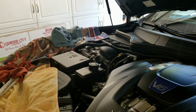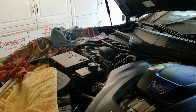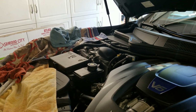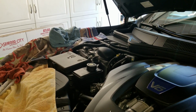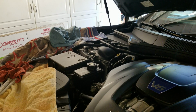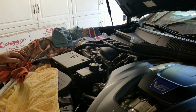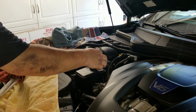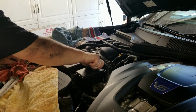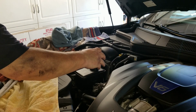Okay, I'll turn the steering wheel now. I'm turning the steering wheel. No noise, the pump's nice and quiet. The steering wheel turns nice and smooth. I don't feel any binds or no hesitation. I'm watching the front wheel while I'm in it. I don't see the front wheel vibrating or anything. I'll check the fluid again. And it hasn't gone down this time.